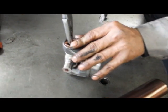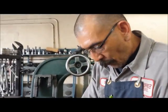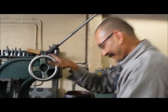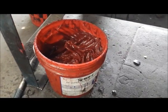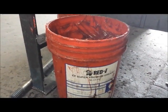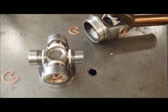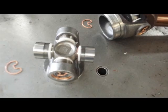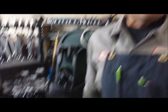Now what size is this? This is a 1350-series U-joint, found in most one-ton and bigger pickups, but it also became a racer's dream — it will not break. That's good because we're going to have a lot of torque going through ours. When Tomas was assembling these U-joints, he was grabbing grease from a bucket of EP Super Premium grease. That goes into all the joints prior to going on your car, so it's lubricated and ready to go — no need to add any additional lubricant. These are solid OEM factory U-joints, good for about 75,000 miles.